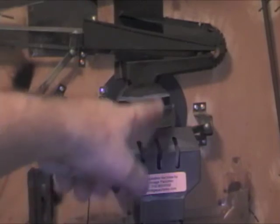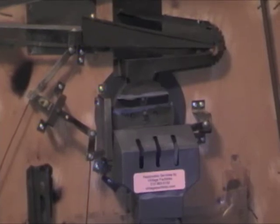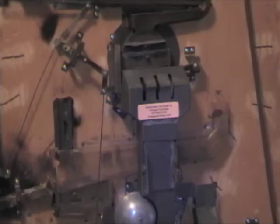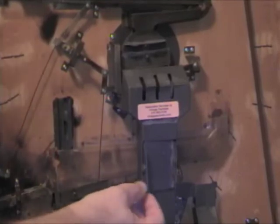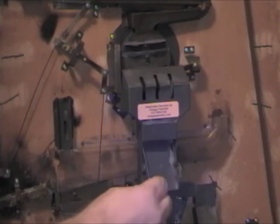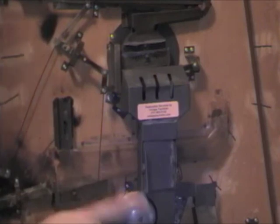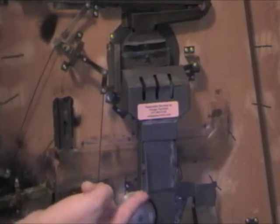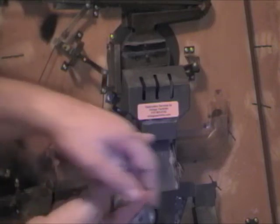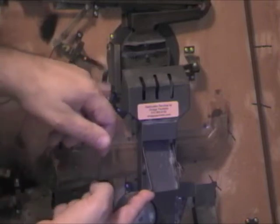the jackpot back here, which is full of balls, if you needed to clean out that jackpot, one option you have is there's a spring on this side, and this just pivots back and forth. Right now, if I get a jackpot, the balls are going to drop straight down, hit this bell, hit the other bell, and go down to the front. But if you pull this way and then get a jackpot, the balls will roll out here, and you'd have to catch them in back. In this case, they'll just fall on the floor.